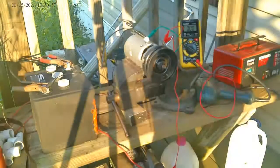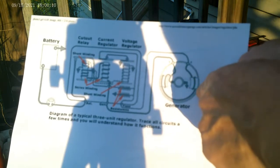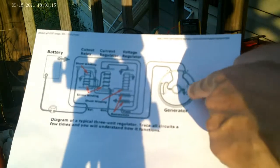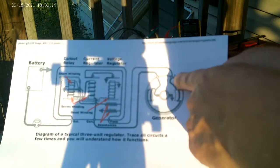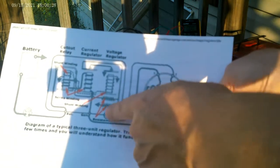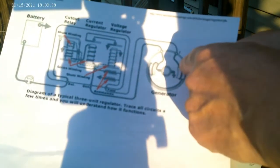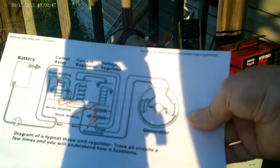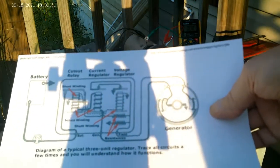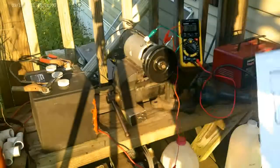The other diagram shows the wiring of the six volt generator: the carbon brush goes to the ground of the housing, which is why you ground that extra wire. Your DF terminal up here goes directly to the ground field on the other side. The positive comes in to one carbon brush, then goes to the field coil and comes around to the other field coil, which exits through ground. These are from the Second Chance Garage articles, which are very helpful. According to the diagram it's supposed to go clockwise — so now we're going to hook it up.